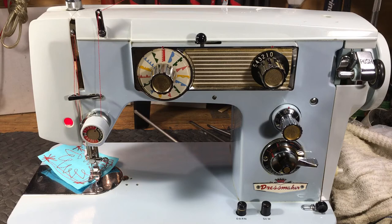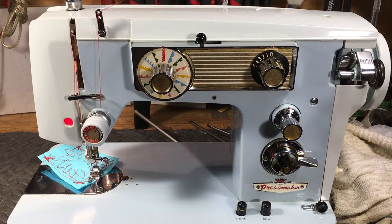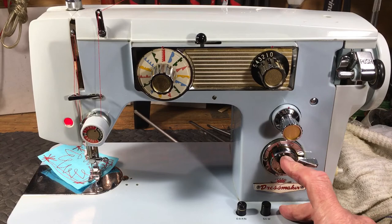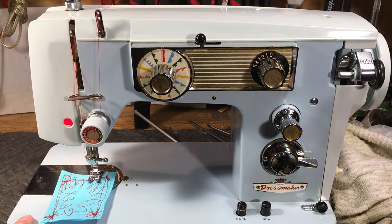This machine is worth the effort. I told her it was made in Japan — bring it in. If it's possible to get it going, I will get it going and I'm determined. You just have to know the techniques: soak them with plenty of super penetrant. Doesn't matter who made it — you have to soak those parts. You don't get a screwdriver and start prying or pounding. You get patient, you lube it and work it, lube it and work it, and finally you'll get a machine that is very precise, works like a charm, sews beautifully and will make you proud.